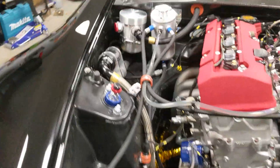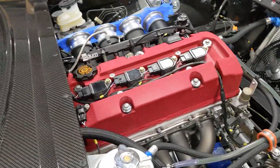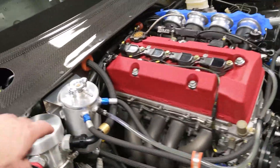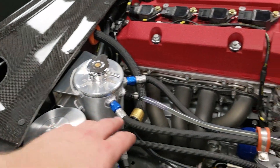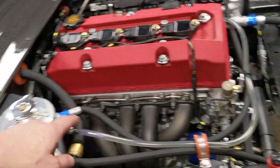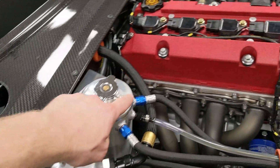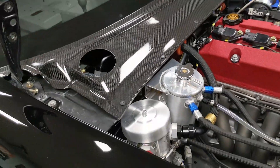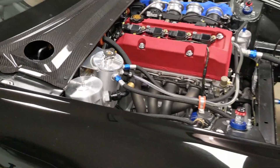The last piece to talk about is the header tank. As you can see, it's at the highest point of the whole engine bay — just maybe 10 millimeters below the hood when it's closed. All those vents pump into this tank. About two-thirds of it will be filled with coolant and the rest is air, keeping a column of pressurized air to allow the coolant to expand and contract as it heats and cools — so it doesn't have to keep spitting out and sucking in coolant. If you see fluid squirt out of here, you probably have something wrong. A tip I was given: run a little line from the header tank overflow and tape it to your windshield, so if it does squirt fluid you'll see it come up on the windshield and know to pull in before you overheat or grenade your engine.